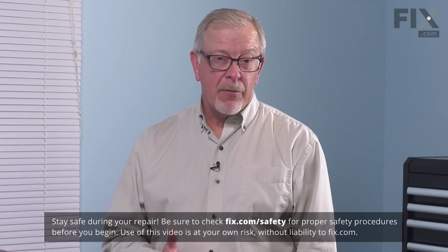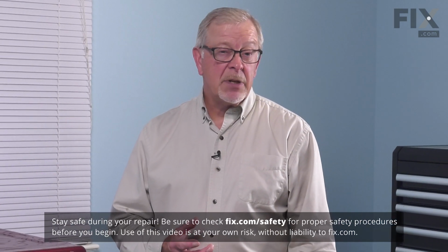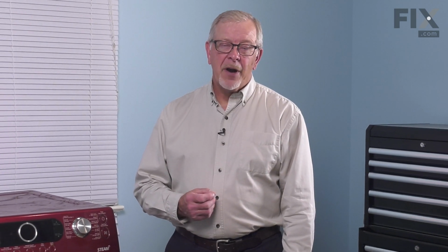Now, to do this repair, we will need to pull the dryer far enough forward that we can access the back. You may possibly need to remove the vent from the back of the dryer to do so. As well, we'll need to make sure that we disconnect the power. So either unplug the dryer, or locate your electrical panel and turn off the appropriate breaker, or remove the appropriate fuses. Once we've done that, we can start the repair.